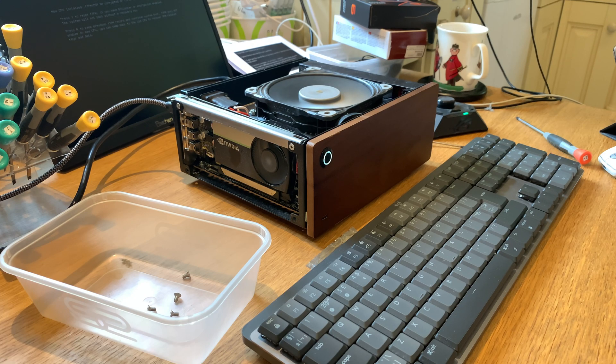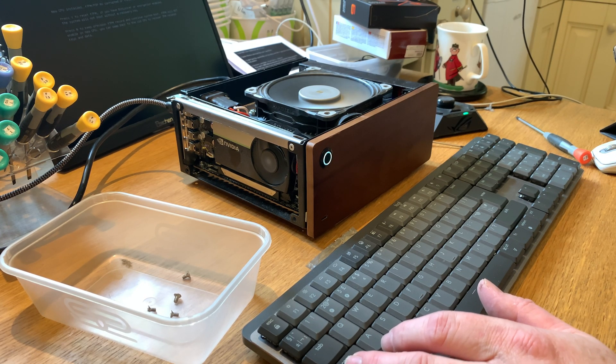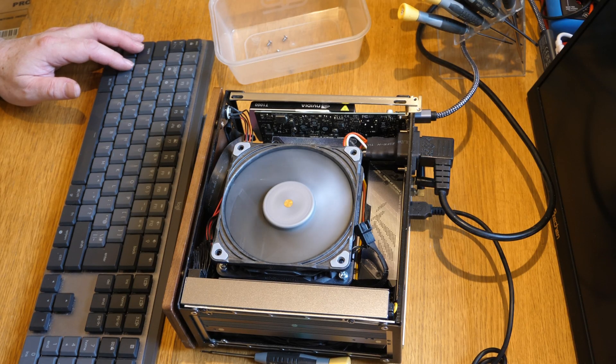We had a little problem because of TPM — I couldn't remember whether we'd got BitLocker installed or not. So check whether you've got BitLocker installed, and also turn off TPM before swapping the processor. Now we're going to look at some benchmarks. Thanks for watching.